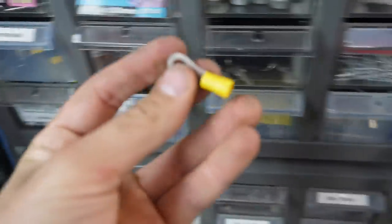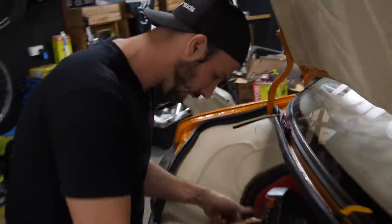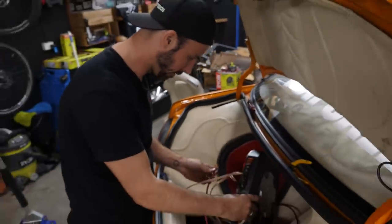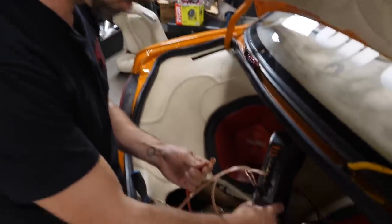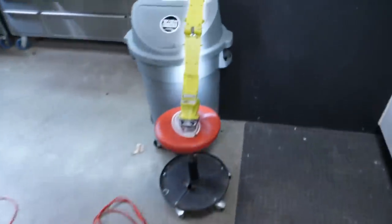I'm only going to assume that the black cable in the back here is negative, even though you think it's red, don't you? From what I can tell, everything down there is grounded. But why is there a ground? There's a ground coming from each side. I'm going to show the people, because I think the subs have not worked while the stereo has been.